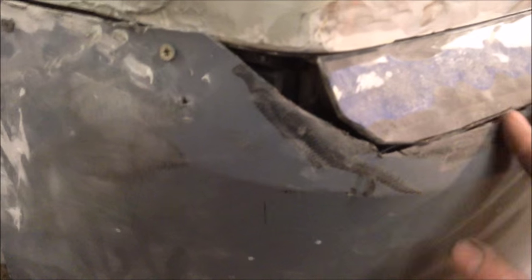So I've got the boring task now of literally, yep, that is it. I've got to do a V, get my V all the way across here, and then put my filler rod in. So then that'll keep it in position while I work on the bracket and everything, remember I put the two screws there to retain it. So this will get plastic welded. And then when I move that into place there, like so, I've got to trim all this, put my end section where I want it, and then put my middle section in, like I did the other side. So, long night.